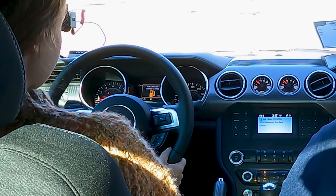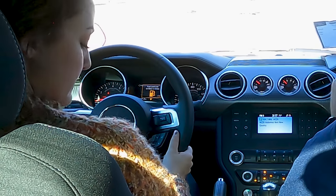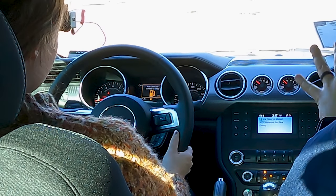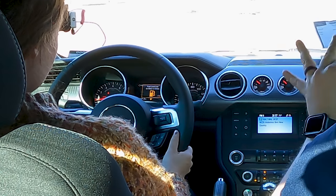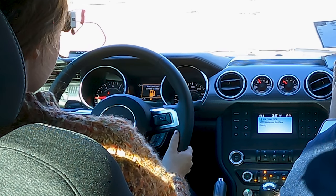So you can let your foot off the brake since we've got the e-brake on. I want you to see how much gas it requires. We're not moving, we're just testing the throttle. Try and give it just 1500 RPM worth of gas. That's perfect. That doesn't take much, does it? That's barely anything. And that's where most people get messed up.